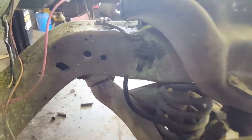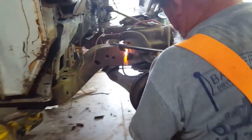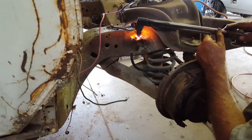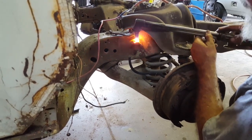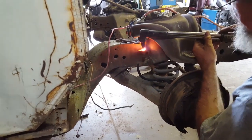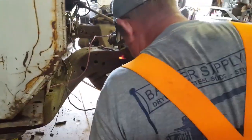Get it broke free up off the line and then you can twist it the rest of the way out. That'll keep you from having to put a new brake line on. These right here have got drum brakes so we got double duty. Pops is going to heat them up and I'm going to go behind him and loosen them up. As you can see he's heating up the hose itself. We went ahead and cut the hose because if you leave it together it will pop. It's a shame we weren't filming - we did the back one and I about jumped out of my pants. So we figured we'd catch these and see what happens. Just got to get a little bit of heat on them. You could go to the hardware store and get one of those propane torches, it'll work just the same.